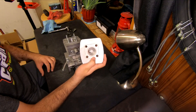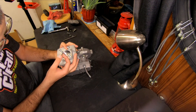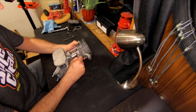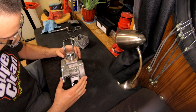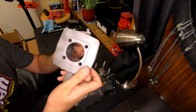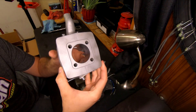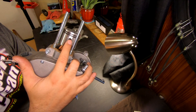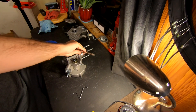As for the Firestorm Zeta 80 and our official review — if you've been following the channel for long enough, you know that we've kind of been unofficially reviewing this motor for years. We've been abusing it, torturing it, and sending it through conditions that most normal motorized bikes would never see. Link in the description to our last video if you want to see a little taste of what it has gone through over the past three years. This new Firestorm is no exception. Upon arrival and initial inspection, the cleanliness and build quality of our newest Firestorm appears to be a bit better than it was with our original kit we got years ago, so that's a bonus. We did have to address a few issues adding a little bit of grease to the bevel gears and the clutch cam, which seems to be common throughout motorized bike kits, but all in all I couldn't see any major issues with this motor.